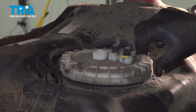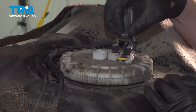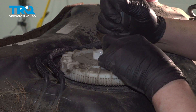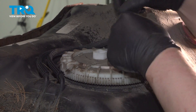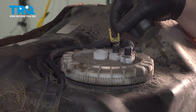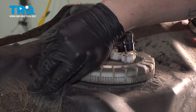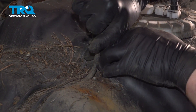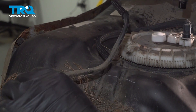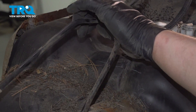We're going to open up and pull back on the yellow tabs — push them out to the side, pull straight back, and remove the clamp. Do the same thing on the other side to remove the locking tabs. Remove the fuel lines from the top of the fuel pump, and now pull them out of the mold on the tank. Put these fuel lines to the side.